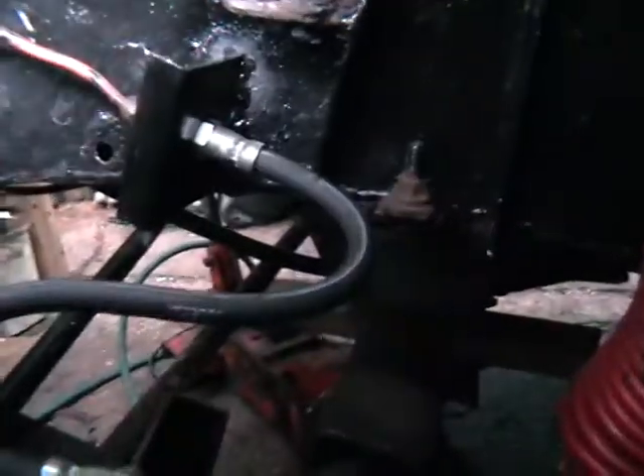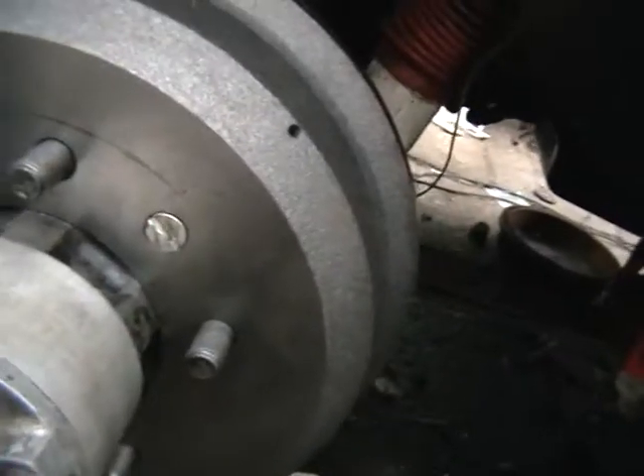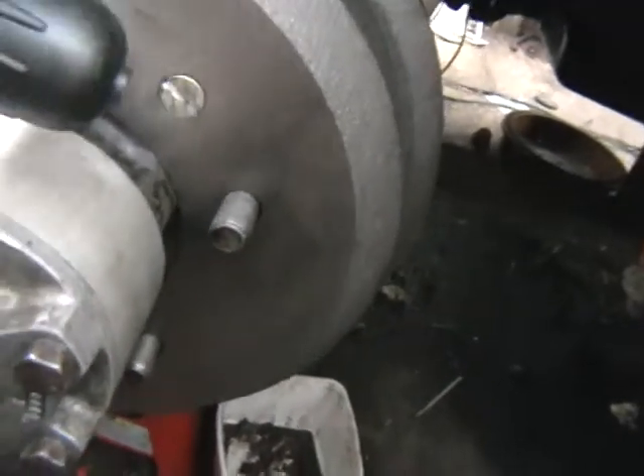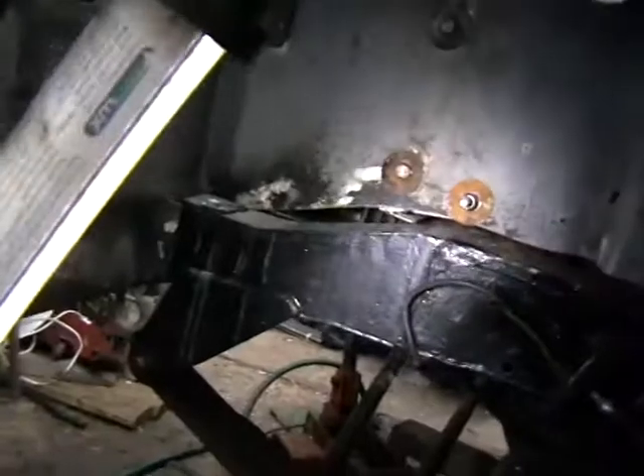It's all buttoned up now. New brake pipes are on — I don't know if you can see them, it's upside down — and the new cylinder, the new drum, the wheel hub. That's all working okay. All the seals are done. Filled up the swivel joint with oil and this with grease — some seem to have grease, some seem to have oil; these ones have got grease. So that's it for today. Have another go tomorrow. Thank you.